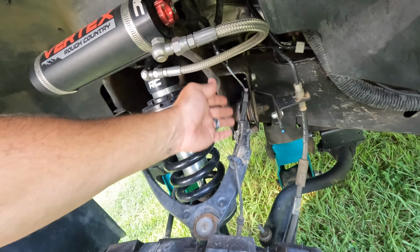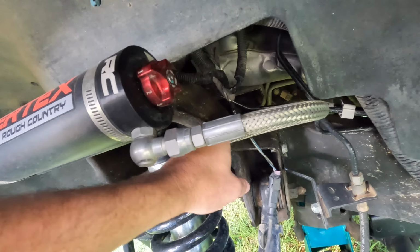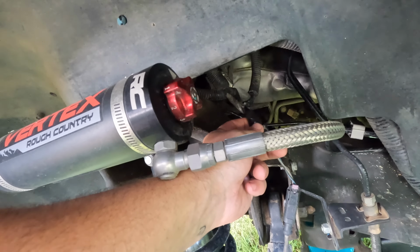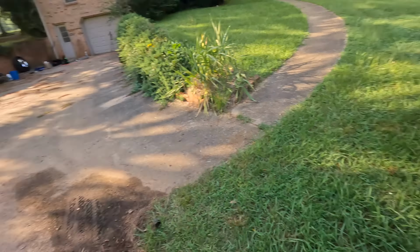This guy right here, of course, couldn't tear it below where you could just buy one of these and replace it super easy. It is up here by all of the wrap with the other wires. Attempt at fix, it looks, it's taped up. He told me it was messed up. And that's why all of those lights are on, because we're not getting a signal to this front tire. And so the truck's freaking out thinking who knows what. But hopefully we're going to be able to take that apart. Hopefully the wire's just disconnected and I can put them together, solder them, and then it'd be fine. No lights, no issues. That's what I'm hoping for at least.